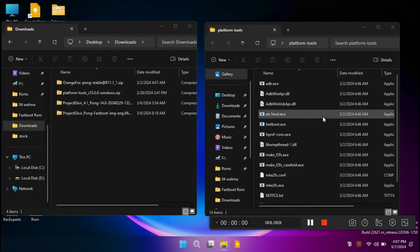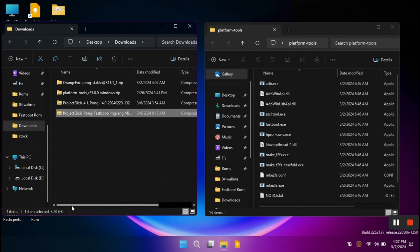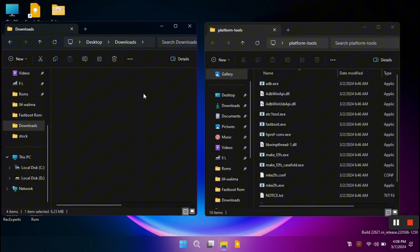If you're not already subscribed, subscribe to Tactics. Now let's begin with the installation steps. We are going to use two different methods to flash Elixir OS on the Nothing Phone 2 — one is the recovery method and another is the fastboot method. I have downloaded both files: Elixir OS for recovery and Elixir OS for fastboot. The fastboot version has 'fastboot' in its name, and its size is around 3.28 GB. The recovery version is smaller. You also need to download platform tools so we can use ADB and fastboot commands.